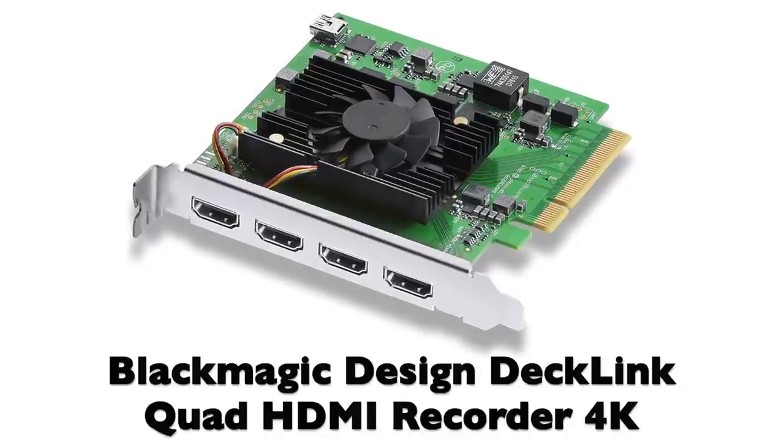Overall I've been very happy with the performance and stability. My desktop computer currently running this production has an i9-9900K, 32 gigs of RAM, and a GTX 1080 GPU pulled from my gaming machine, and it's been working great at 1080p 30. I'm going to try 4K 30 at some point and I'm pretty sure we'll be okay, though I might upgrade the GPU if I start driving multiple 4K sources. I do have a Blackmagic card in the desktop for video input — it has four HDMI inputs, is rock solid, never drops a frame. Whenever you can, try to wire in your most important cameras, though NDI works great too.